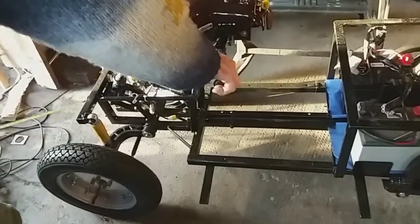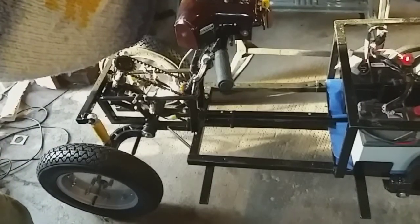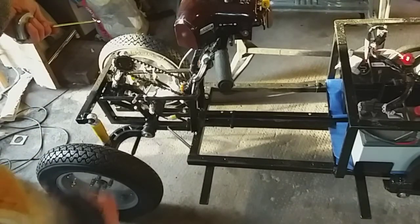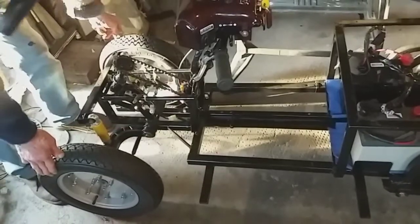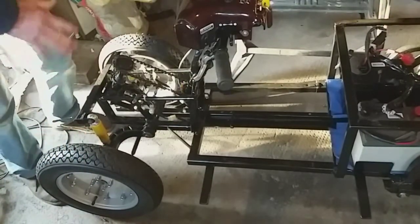When I got this scooter, for some reason the tracking was going outwards - the front wheels. And if you try and drive one like that, you have trouble; the steering's all a bit wonky. You need to clamp something on here and make sure the wheels are parallel, or fractionally in - not loads.